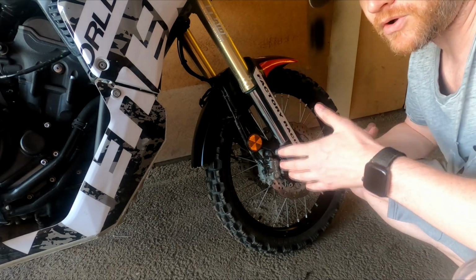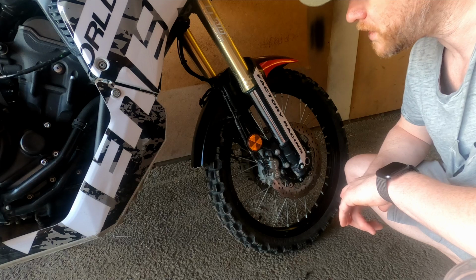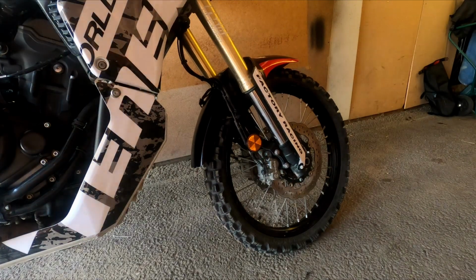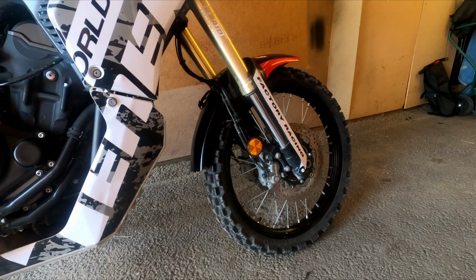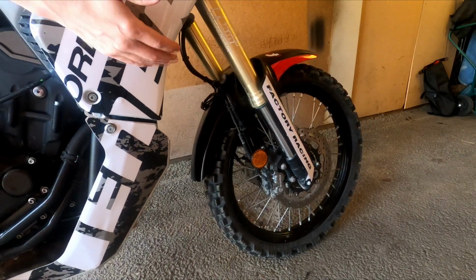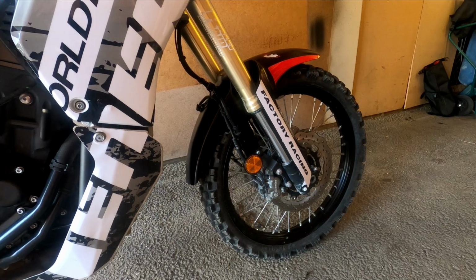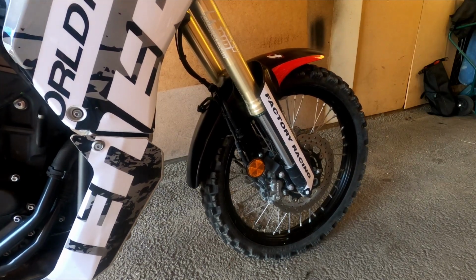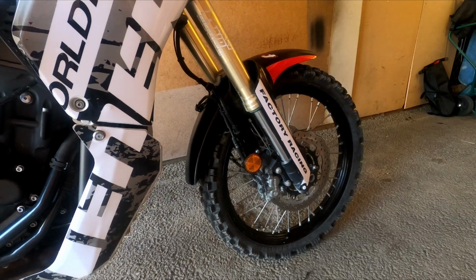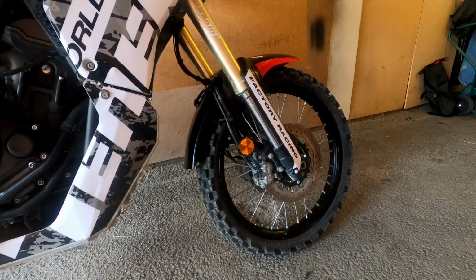After that, you put on all your gear that you have when riding, all the luggage that you're supposed to have with you when you go out riding, and then you mount the bike. So I will do that now. If you're two people, it's a bit easier, because if the bike is cold and the suspension hasn't been moving up and down, you might want to work the suspension back and forth a bit, but then you need to push up the O-ring or zip tie again, so it's not pushed down. Then I put my feet on the foot pegs. I balance towards the wall here with my left arm, and you sit just normally as you're sitting when riding. You can stand up as well, but don't do any sudden movement, because you might push the suspension down more than you're supposed to. Then I carefully dismount the bike.